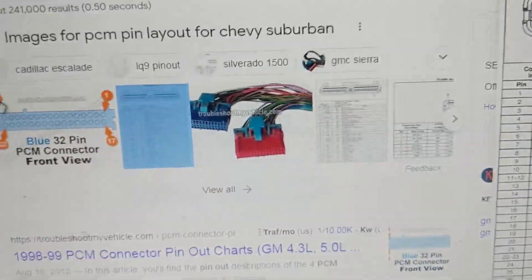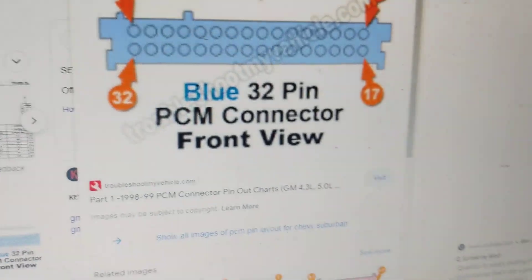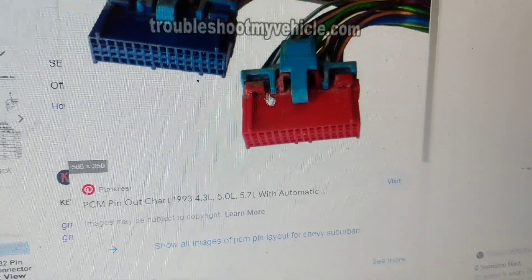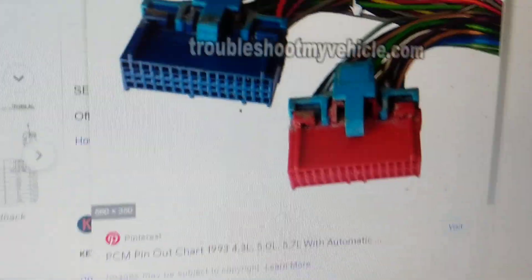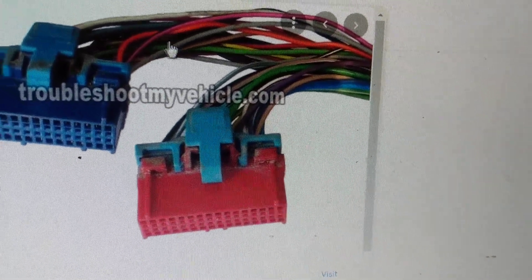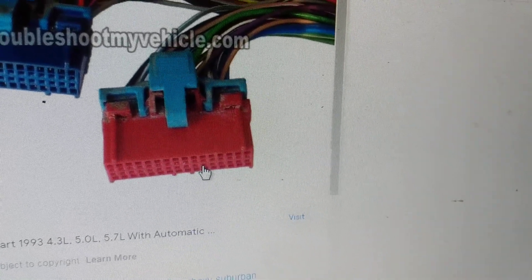Let me go back to the summary. Know the layout of the pins, know their functions, and the color is obviously very important. Don't get mixed up and look for a red wire when it should be blue — everything should match up. Sometimes the color fades, so a white wire might look gray, so don't always rely solely on color.